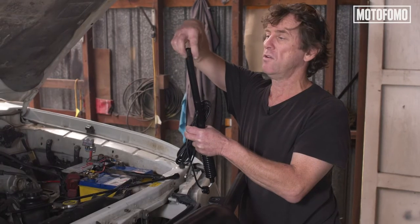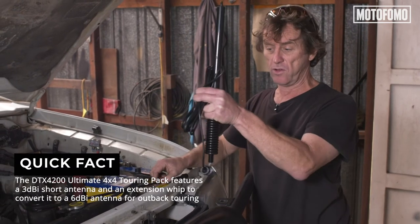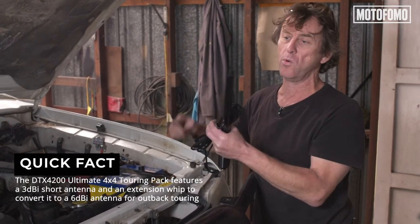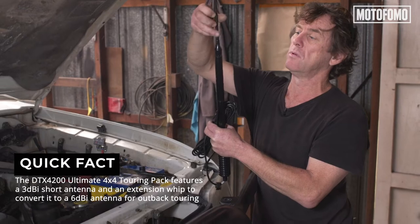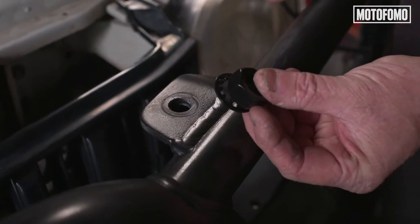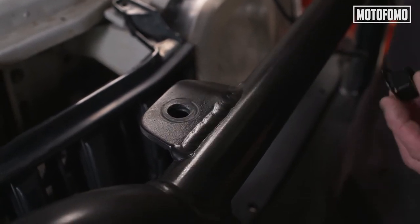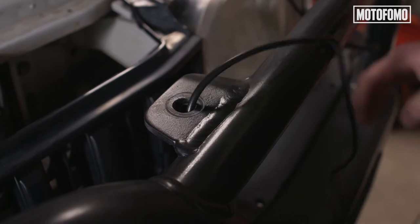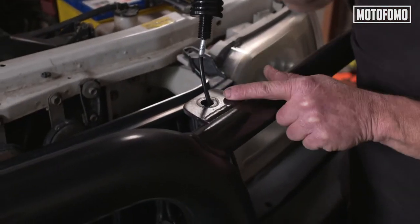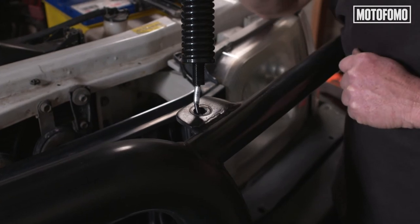What we need to do next is install the aerial. This little Oricom aerial is actually a pretty good bit of gear — it's got a short stubby base for short-range work and an extendable long piece for outback work, so that's pretty good. Here's a little tip: make sure you take the nut off the bottom of the aerial before you start feeding the wire through the hole. And something you might have to do on some vehicles is make the hole in your frontal protection bar — your aerial mounting tab — a bit bigger.